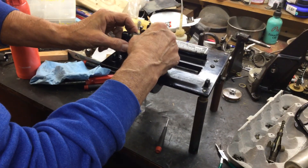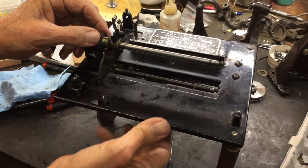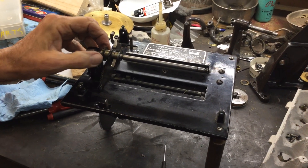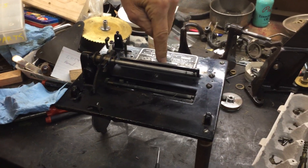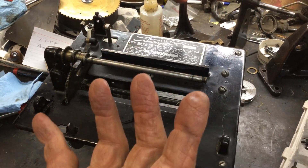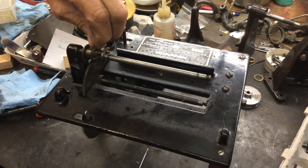Then this — when I pull it apart, there's still tension. So now everything's loose. Now you're going to have to take this screw out and these two screws out — these two and these two. We're going to have to flip it over and then pull the whole motor assembly off so I can get this gear out. This is a lot of fun and that's my tip for the day.